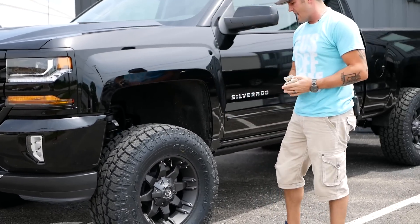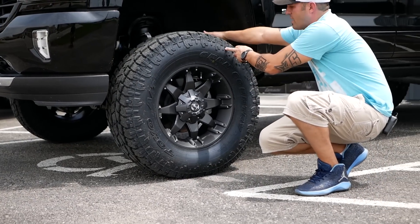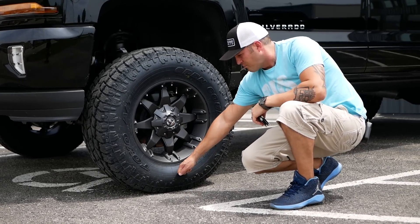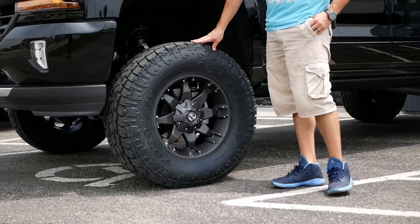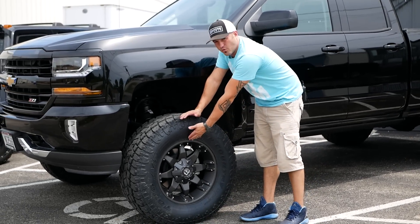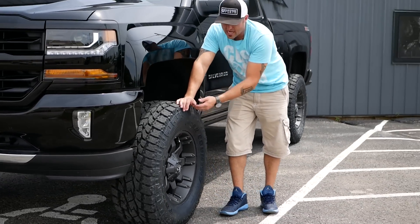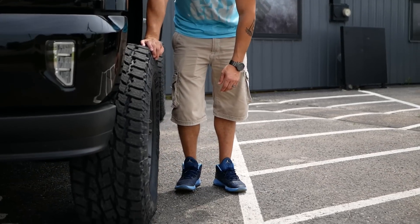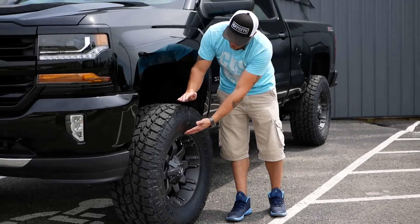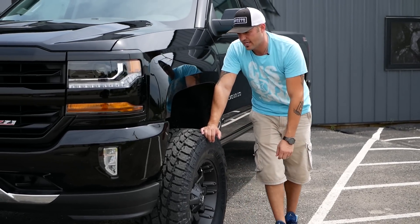And then that's going to be wrapped in a 35, 12 and a half — it's a Toyo Open Country AT2. 35 high, 12 and a half wide. Because you've got that 12 and a half wide on a 9-inch wide wheel, you're going to have plenty of sidewall. This is going to be your more off-road setup, because the wheel's going to be protected by the tire. You're also going to see a lot more sidewall because you're on an 18-inch wheel on a 35-inch tire, which is going to make for a much better ride. When guys are looking at tire or wheel sizes, that's what you're thinking about — if you want ride comfort, the more air between here, as far as the sidewall, the better ride you're going to get. You're literally riding on that cushion of air.